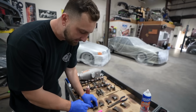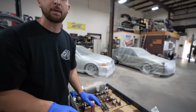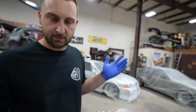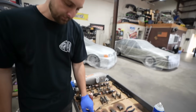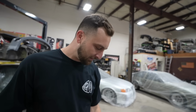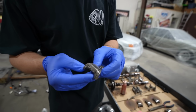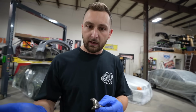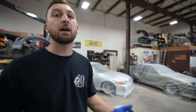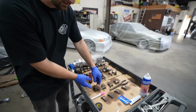And so what happens is, potentially at high RPMs, or if you have a way too aggressive limiter, if you just rattle your valve train, as I say, these little shims can go flying out and cause all sorts of chaos. Hopefully it ends up in your oil pan. This rocker can go flying, and then it gets wedged, it breaks, and you have a broken rocker sitting there, which sucks. These are really expensive, or it can damage your cam. And so if you ever heard someone say, oh, I threw a shim, this is what we're talking about. It's these little shims right here.